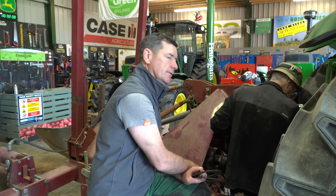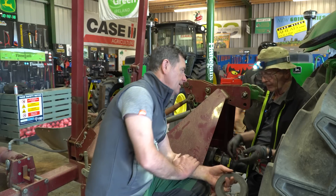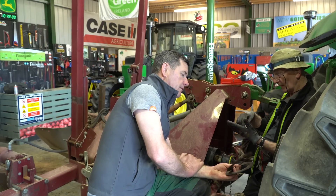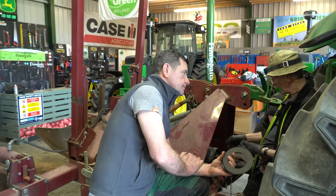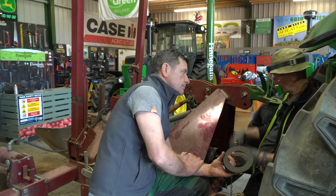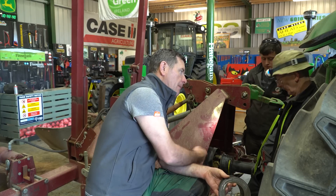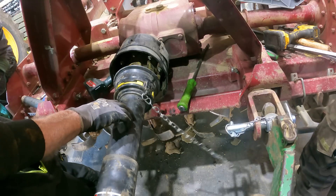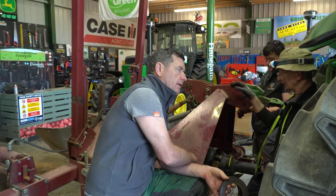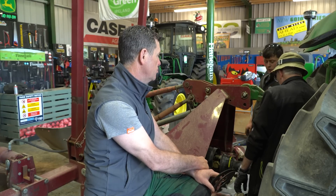When you put the new plates in, the steel parts had glazing because it was slipping - it's like brake fading on a car, you have no grip. So you deglaze, cut the surface of the steel plates again, then new discs - did all that on the steel plates. We tightened it almost coil bound and put a feeler blade in at about 0.1 of a mil between the coils. We've tightened it up, backed it off, and we're going to bring it to work. Hopefully that should be good to go.